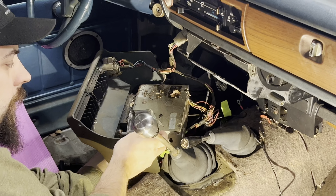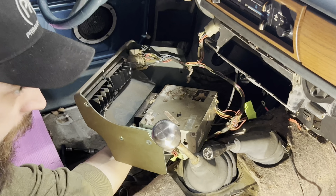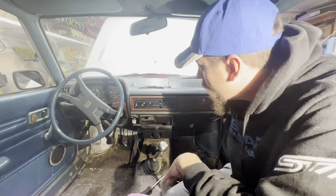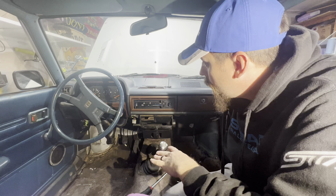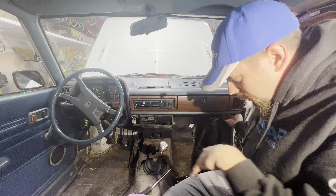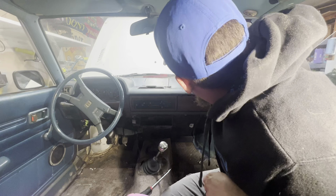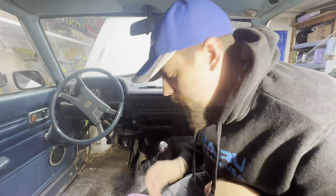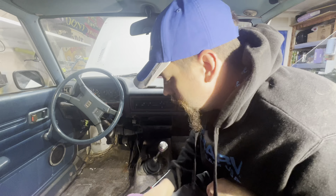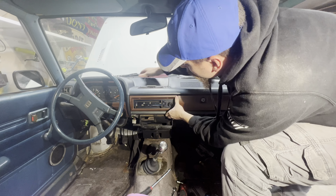I can finally fix my clock with the bent second hand — that's good. Now for the rest of the dash: I've already removed the radio and some of the AC stuff. I'm going to pull off the dash — I think I have it loose. It's really only one bolt right here, one bolt on the opposite side, and then three across the top. They're all 12 millimeter. I'm sure I'm going to be hung up by a bunch of electrical stuff but we'll deal with that once we get it loose.